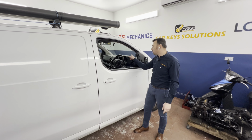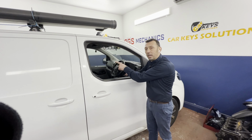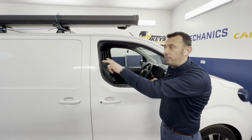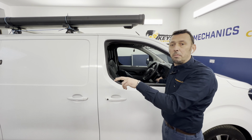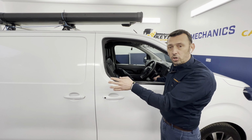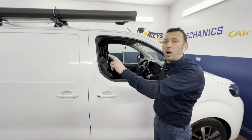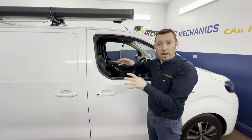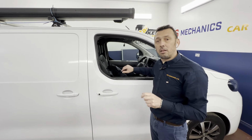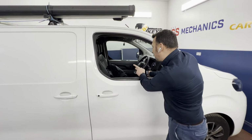So this is very interesting, and we're just going to show you. So we've got the reverse engaged. We're only going to switch on the ignition, and we're just going to listen for the beeps because we have 2 sensors disconnected. We should hear a long beep, and then after a short break, 2 beeps indicating the second sensor being faulty. In our case it is disconnected, but even if they are faulty, you're still going to hear exactly the same sound. And again, we're going to hear 3 beeps because this central right sensor is defective. So let's see.